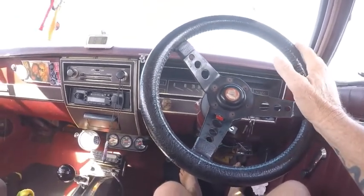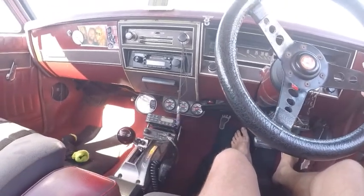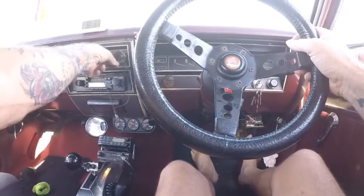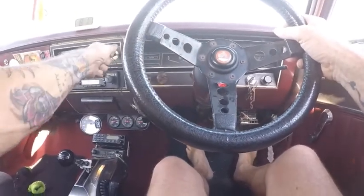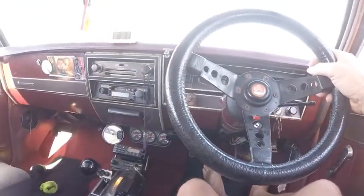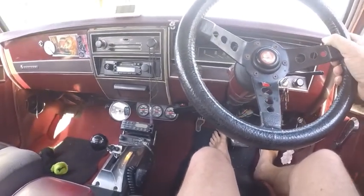Alright, so up comes the temperature gauge on the left side. I don't know if you guys can see that. So it's the left side temp gauge, but that's actually reading on the right bank. So, for those who are unfamiliar, what's been happening is the left bank of the car has been running way hotter than the right side. I've got 2 temp gauges down there. So the left bank of the car has been running hotter than the right bank. Now, I wasn't sure if that was true or whether it was just a temp gauge.